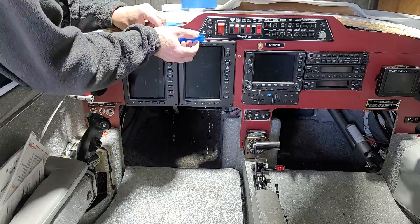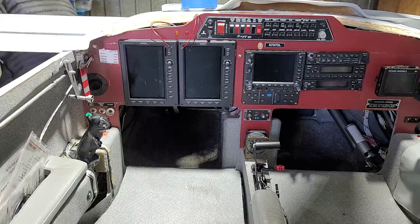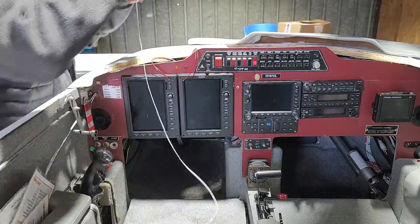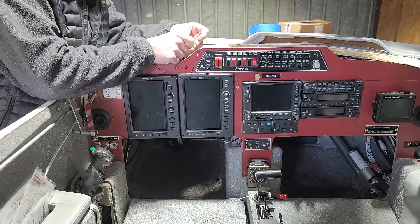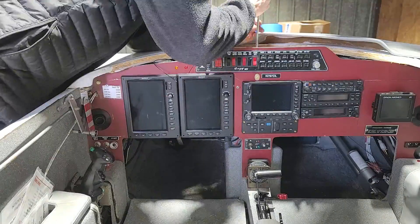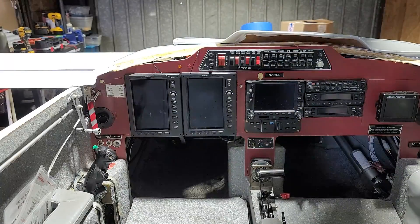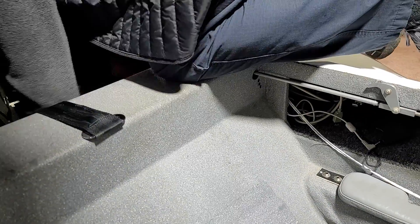The lights are colored yellowish-orange and red to match the colors of the CAS message. The reason I'm doing this is the Garmin G3X with the EIS — the GEA24 — can actually do this. I'm crimping all the wires together and figuring out where it's going to be powered from. I have CAS messages come up, for instance, when the cylinder temperature is getting too hot, and I'm missing them because I don't happen to look down and maybe I didn't hear the alert noise.